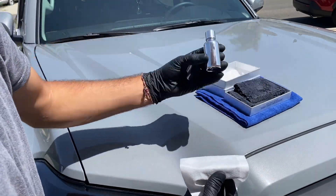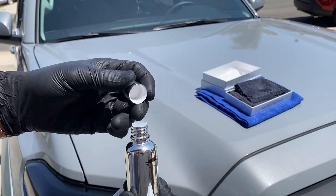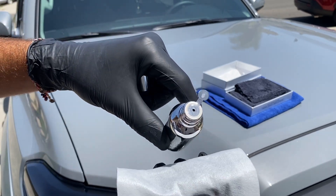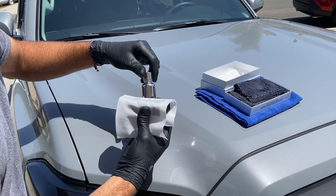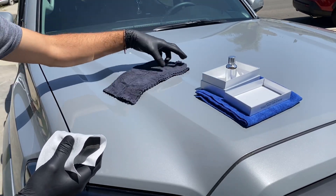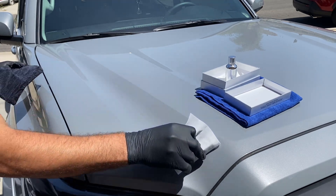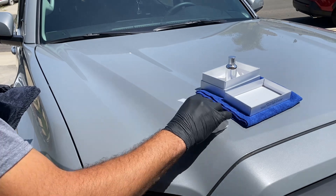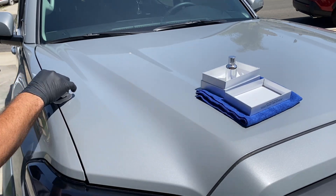Now it's time for the ceramic coating. Grab those little white pads that come with it and place one over the foam brick. Shake the coating well, open the little tab, and apply only a small amount — maybe a little line of about seven drops. You don't want to overload it, but don't put too little either. Close the bottle so nothing gets in and it doesn't dry out while you work. Have your buffing towel ready. The directions said it won't haze but will show a little rainbow effect when it's ready. Apply in a cross-hatch pattern — up and down and then side to side — and do small sections at a time so it has enough time to dry without overloading or under-applying the product.